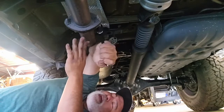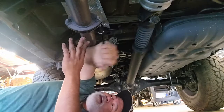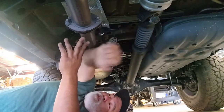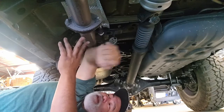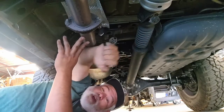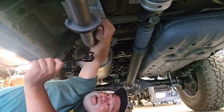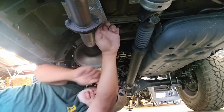In the case of any kind of modern vehicle equipped with a catalytic converter, water vapor is a byproduct of getting rid of the extra hydrocarbons. Of course, that H from the hydrocarbons is the hydrogen, the C being the carbon portion. They break up and form H2O when oxygen is combined with it, and that's the water vapor we see. And that extra oxygen combines with the carbon as it converts into carbon dioxide, and in an incomplete combustion, actually carbon monoxide, and that's the harmful gas that we get out of the emissions gases. So don't worry when you see the water, that's a perfectly normal thing. That seepage should stop once we get the gasket back in it and the new system on.